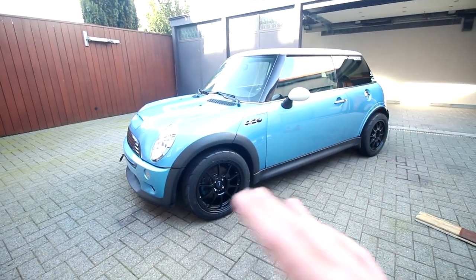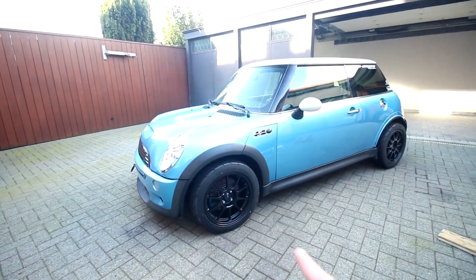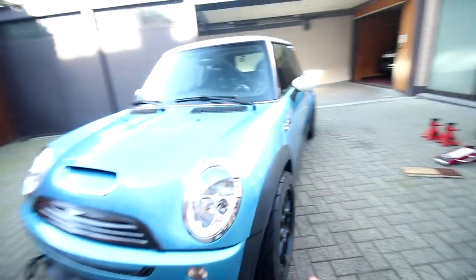This looks gorgeous. Now one thing that didn't make sense to me was that this is a 225 and I thought the wheels were the same offset — but AVP from the future here to correct that: there is an offset difference between the Decagram wheels and the Ampliforms. The Ampliforms have a 45 offset and the Decagrams a 35 offset, which means the Decagrams sit one centimeter more outward on the car. That explains why I have more inner fender clearance and why the wheels poke out a bit more. Just needed to clarify that for you guys.